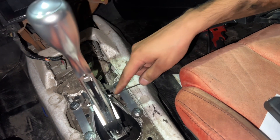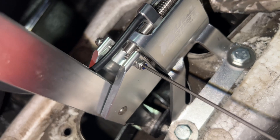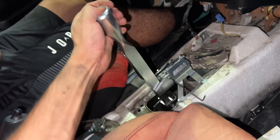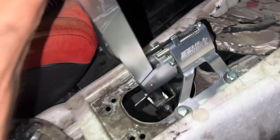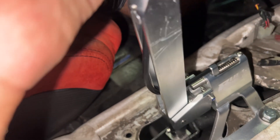Time to go to the top, adjust the shifter, and go drive. You can tell I can't go to first right — that's where these little pins on the side are meant for, to prevent you from going in. When you press this piece in, it pulls the little pin back, allowing you to go to first. Many people might wonder why that's important: if you ever have a money shift situation, you can set it so once you're in second and go to third it prevents you from going back.